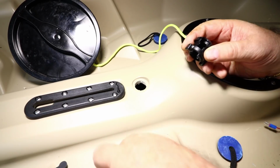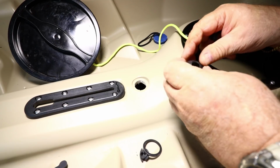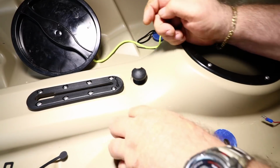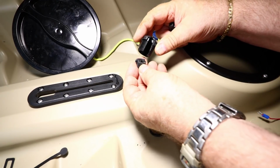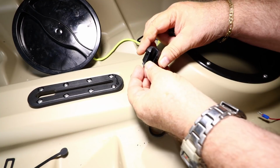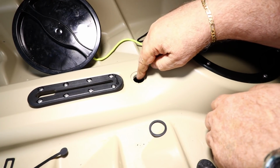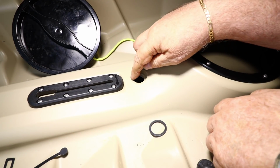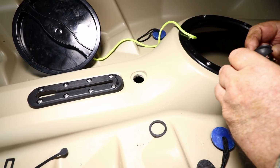Well, I sat here and worked and experimented with trying to get this Hobie through hull adapter to fit through here, because it threads in there perfectly, but I had a lot of difficulty getting the grommet worked up into position as it's supposed to be. It proved to be quite difficult from the underside. Also, from the underside, there's a lot of rough surface. I tried to trim it up with a knife and a razor to get it flush and even like the top is, but it just seems to be impossible.